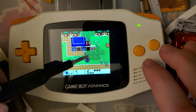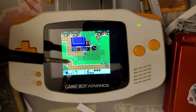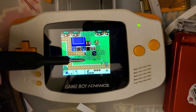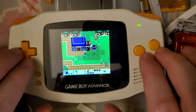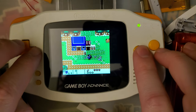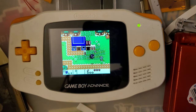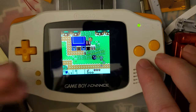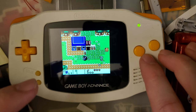The first, we're looking at this guy's chain, because the original Game Boy didn't have a way to do transparency with sprites. So how they worked around that was, because the original Game Boy had a terrible screen, they would just flicker it on and off real quick, and that would give you a transparency effect. Not all kits account for this flickering behavior, and some of the screens are good enough that you could just see it flickering. I don't know if it's the kit compensating for the flickering or if the screen just has worse ghosting than some of the other screens, but the result is the proper display effect. You can still see a little bit of flickering, at least I can in person. I don't know how well it's coming out on camera, but it's way better than other kits.